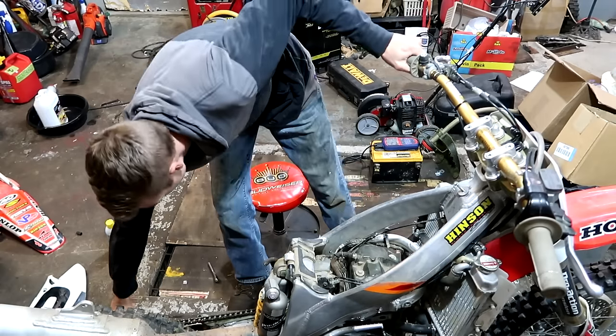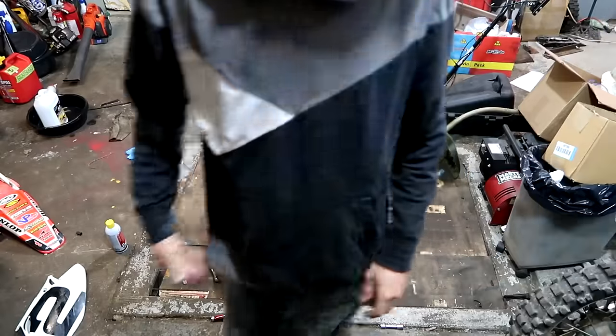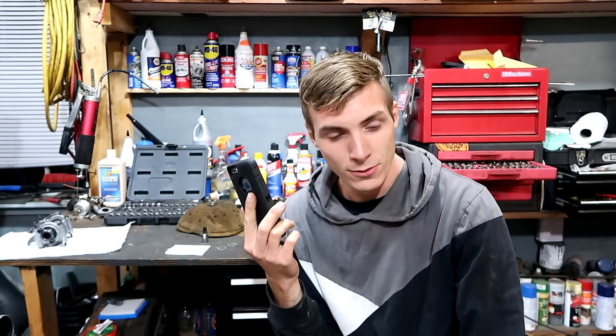It's a lot lighter — hey, I made my own trial bike! That thing does look awesome. Jake, I'm kind of disappointed here — the Honda is a no-go. 'Why's that?' Well, I take off the valve cover, put the engine on TDC, check the valves, and both valves read zero. 'And you know what that means when they both read zero? New valves.' 'Can you adjust it at all?'